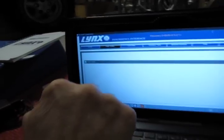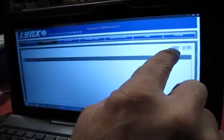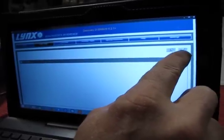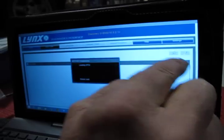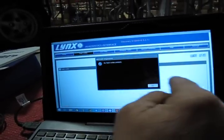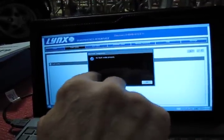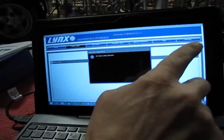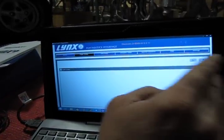We'll start with fault codes — it gives you a blank screen with two small icons in the top right: a magnifying glass to search for fault codes, and an eraser to clear them. Of course you read first. This loads up, and believe it or not, there are no codes in the EMS on this Discovery 2. Should there be codes, you can hit OK, read the descriptions, and then clear them using the erase button.